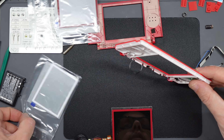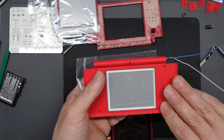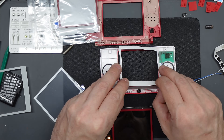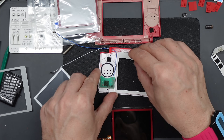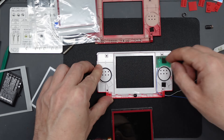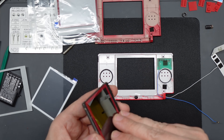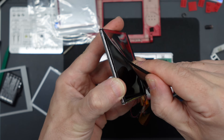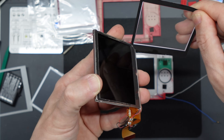When I built the clear one I kept the original top lens as it was in really good shape. However on this one, after cleaning it up, there were a few nicks and scratches I wanted to get rid of, and looking at the Pokedex pictures I realized the red surround wouldn't be as good as the white — thankfully this kit comes with a white surround lens. So I decided to disassemble the top screen and put the new lens on. With the kit, alongside the lens, comes a self-adhesive frame — I removed the center, peeled off the backing, and placed it into the shell. This is tricky to get right so be patient. Then I removed the old lens starting at the corner, getting a thumbnail or spudger in and carefully peeling it off. There were a few small specks of adhesive left over but no raised profiles, so I didn't remove those to avoid adding dust onto the screen.